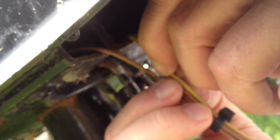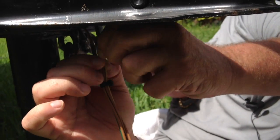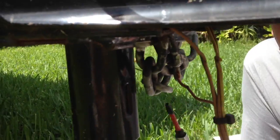the only thing that really happened was it came unattached from right there where it's grounded, and it's really going to be that simple. Now these wires are a little cut up, so I'm going to fix them all, and I'm going to reground this, and that's it. It's going to be a simple fix, and she's going to be on the road. So she's going to find me a nut driver, and we're going to do this. So what we had to do is go to the store and get a number 2 square bit to get that nut off that the ground goes to.